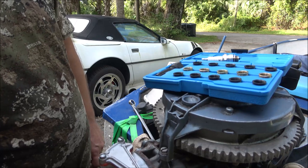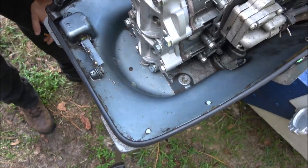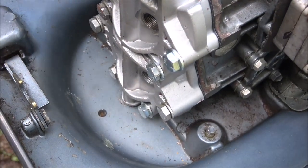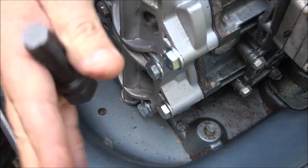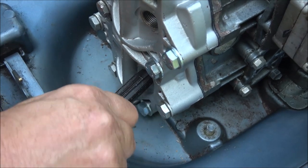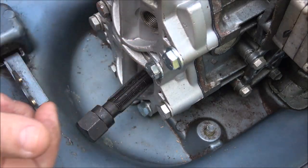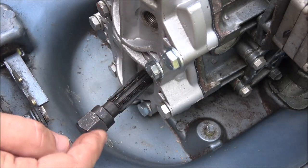The cylinder walls are steel, so a little tiny piece of aluminum should blow out pretty quickly — I'll also blow it out with compressed air. Now, you're just going to start screwing it in there and try to keep it straight. These are at an angle going out this way. If you have your head off or if you got the room, you can use a ratchet or one of the big T-handles. I don't have that room, so I'm just going to put some grease on here.